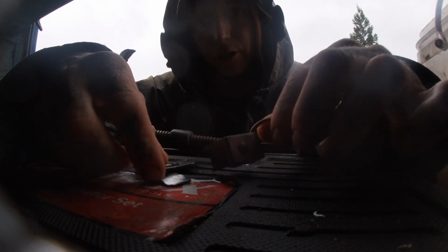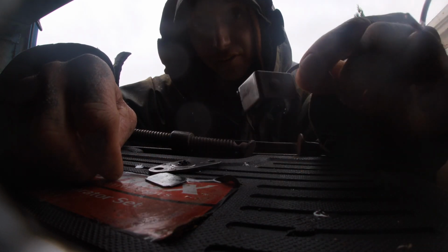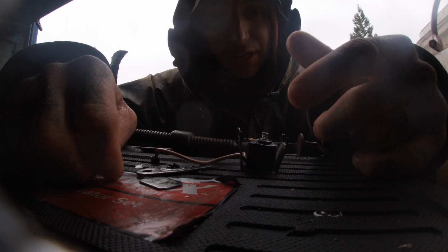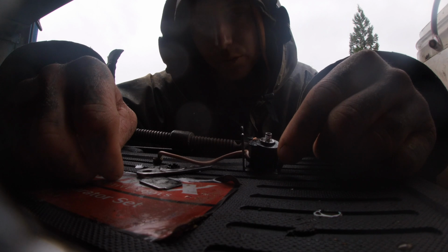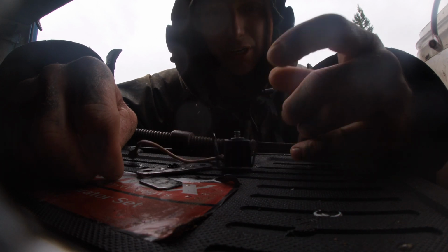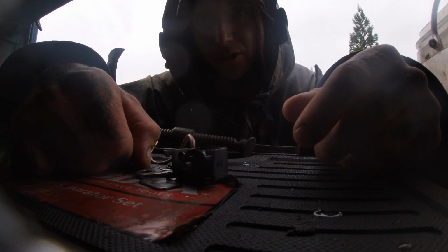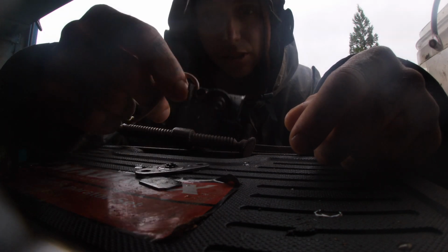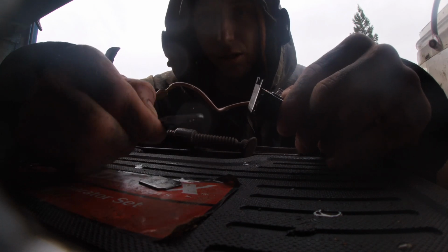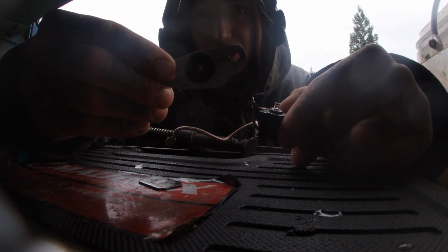So this is my kick down switch. It's a trigger to downshift Turbo 400. I've never had it hooked up, but it's always been in there, on this transmission anyway. I broke it off when I was putting the trans back together, and I thought that I should just leave it out since I never hook it up anyway. But now that the transmission's not shifting, it's setting an alarm off, and I think possibly this has to be there. Maybe what I need it to do is just stop or slow down fluid coming through that screen.